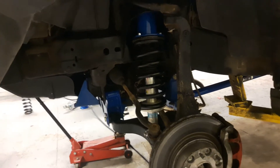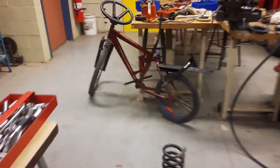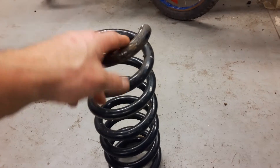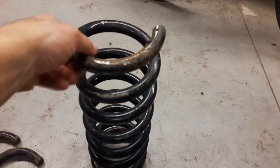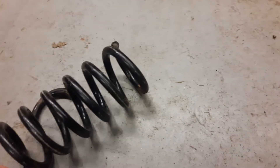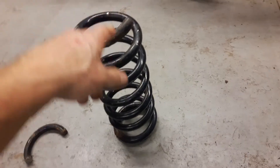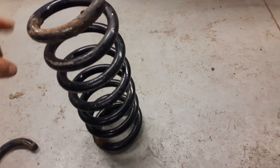So instead of buying new springs, I decided to cut them. I did some research online: one inch on the spring in height equals two inches on the body. I only wanted to come down an inch and a half, so I cut three quarters of an inch off the spring. This spring I just finished cutting — this is about how much of a coil I took off. You start at the top of the spring — not the flat side that mounts to the top of the vehicle, but the coiled side that mounts on the bottom of the shock — because there's a recess right in there. You measure the total height of the spring and then walk your tape around the spring until you get to the desired height.